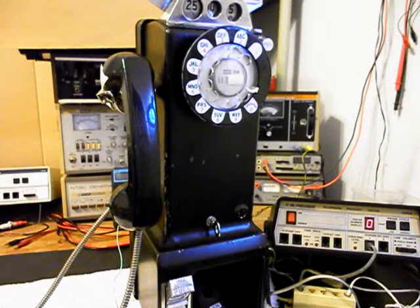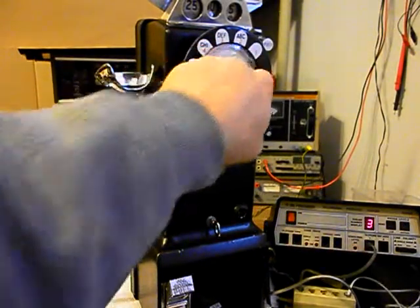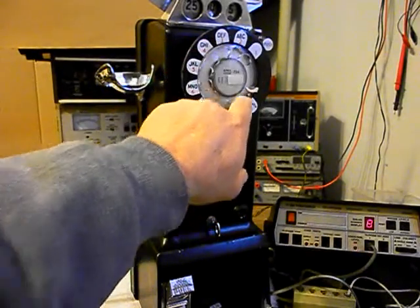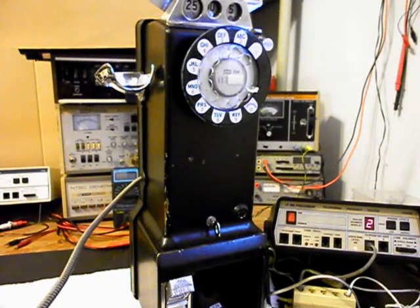We'll let that go a few times. I'll let it go one more time and we'll give you some dial tone. We can walk through our numbers — if you watch the analyzer, you'll watch the numbers roll by. We have a nice, smooth return on our rotary now. Now I'm going to end in a 2. Now I want to transmit into the handset. If you watch that red light on the analyzer, every time you see that red light light up, that's an indication of 100% modulation on transmit.